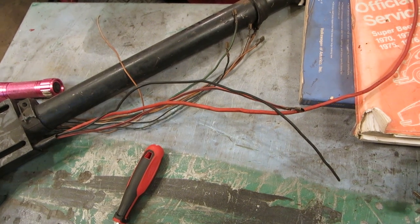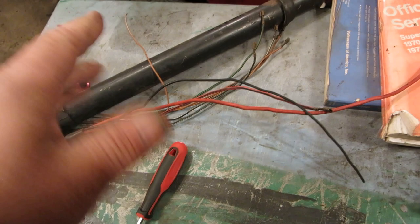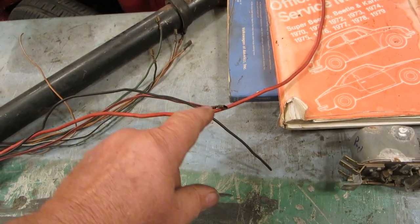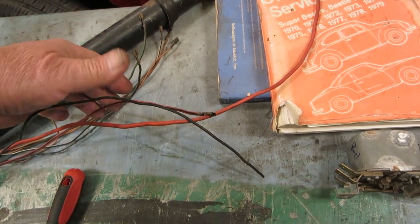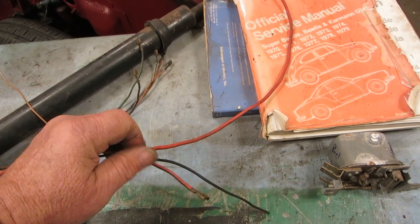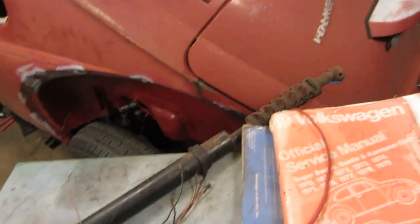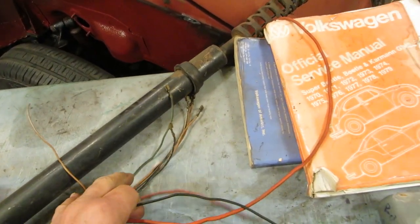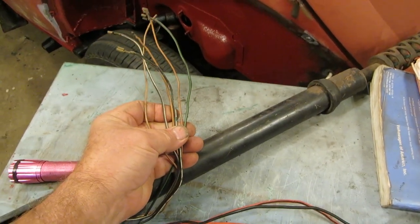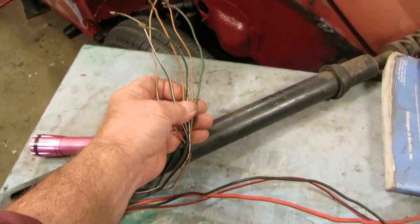The other power from the fuse block comes from the light switch, I think, something like that. I'd have to look in that and see, but this is the stuff to make the car run. And the black and the red is a little heavier wire, and it goes to the signal to the starter that, if you remember, we made a new wire that snaked around underneath there. Okay. And then, indeed, we also have six wires that are going to the turn signal and the lights.